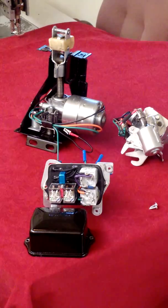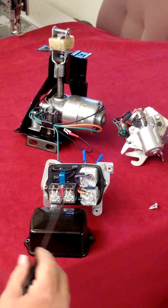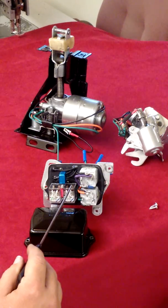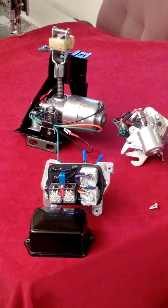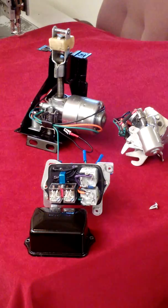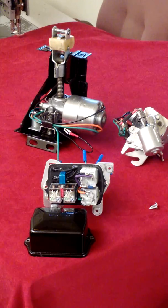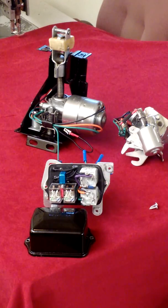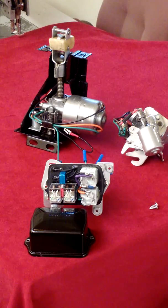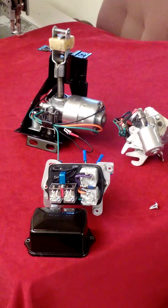The original components were big wire round coils, secondary relays, which cause these big coils to latch and to energize and do all kinds of crazy things. We didn't receive this relay with original parts. Someone had taken an attempt to try to upgrade it. I presume that the original parts had failed, or they didn't know how to repair them, and so they tried to upgrade it and just fell a little bit short. Good effort. I just don't think they understood completely how the components worked in relation to all the other components that this relay has to control. So we started over. We started from scratch.